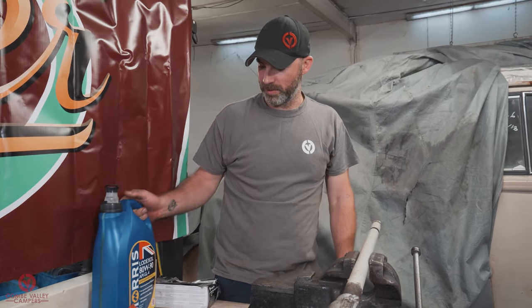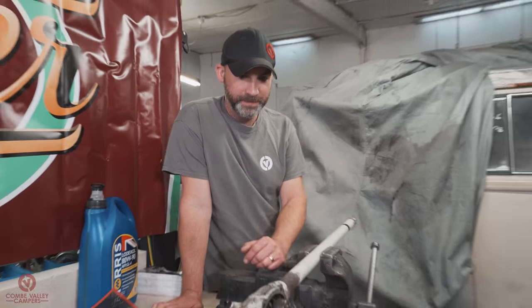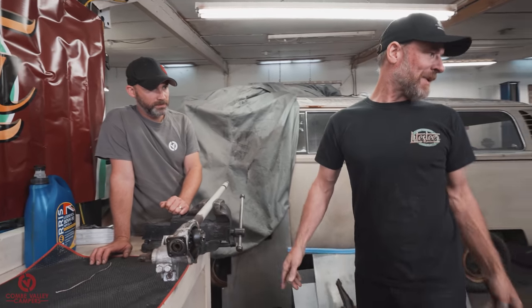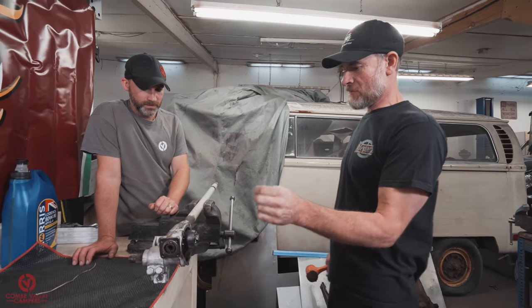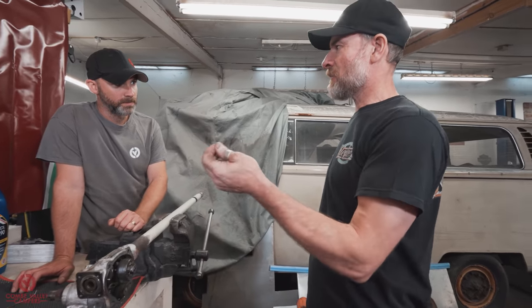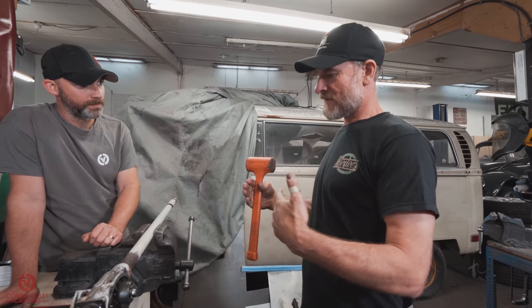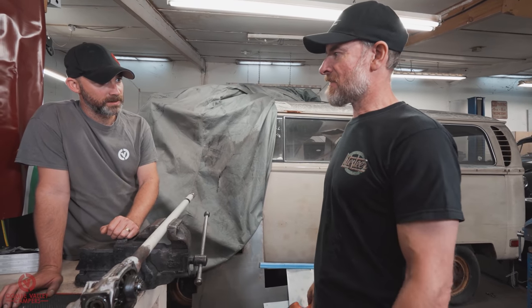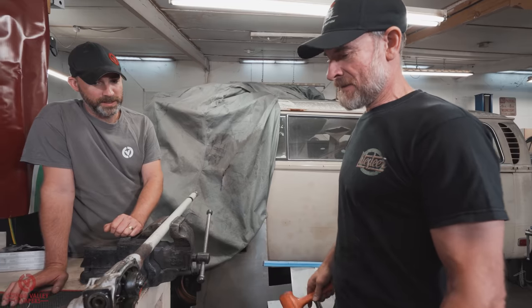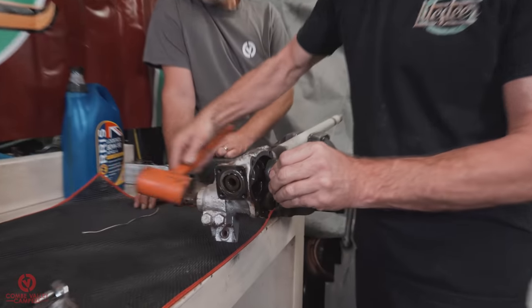Brilliant. And that is just generally a gear oil. Yes, it's basically an EP oil. EP means extreme pressure, so it won't break down. You get two points, like two teeth on a gear. Imagine there's a lot of pressure on that. So your average oil would just break down. And you filled up 1,500 of these, or thereabouts, something like that.